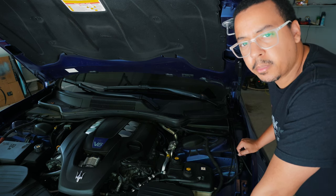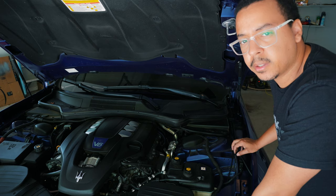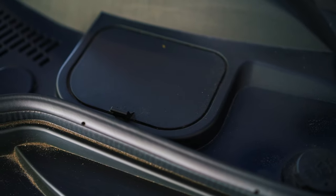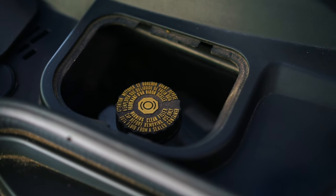I'm going to be doing the brake flush on my Maserati Ghibli SQ4, so some things may be different for you. Please make sure that you look at your user manual and get the proper brake fluid, and do the procedures based on your vehicle. The reservoir for your brake fluid on your Maserati is going to be in the engine bay up front on the driver's side. There's a cover here, and underneath that is where you will see your cap for your reservoir.